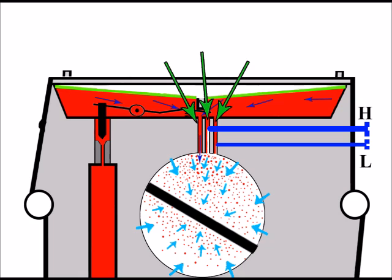The best thing to do as well, if you can't get rid of the problem then, as I've said before, it might be best to look into ultrasonically cleaning the carb. If you don't want to take it to a repair centre to get it cleaned, ultrasonic cleaners are quite inexpensive nowadays, and a good internet search will bring you a good deal. I myself got one off the internet and it was a good price and I use it all the time.